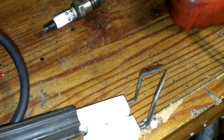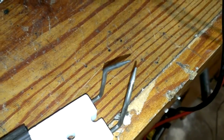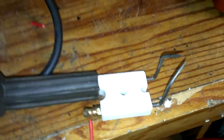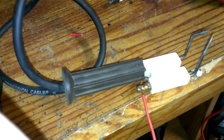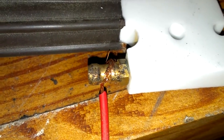Pretty much I'm just going to tap this — and you can see it sparking. Turn the light on. You just do it kind of quick. But you're supposed to have some points and a capacitor to do this. You can do it with a regular switch, but you'll eventually wear out your switch because it will arc — see what I mean?